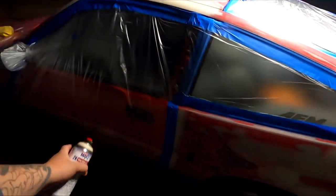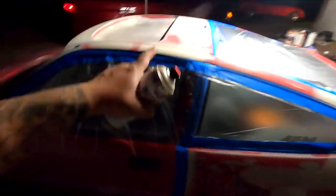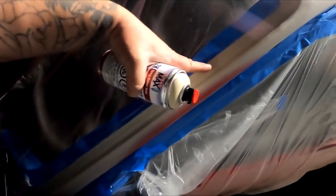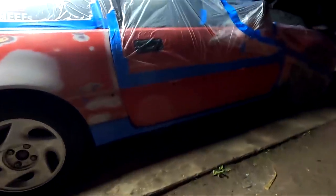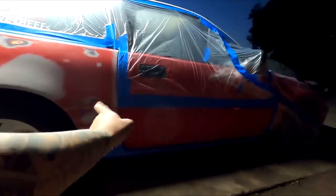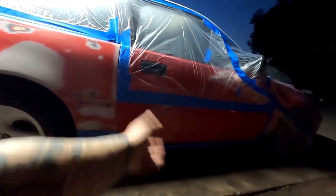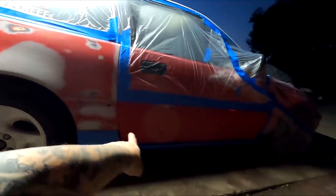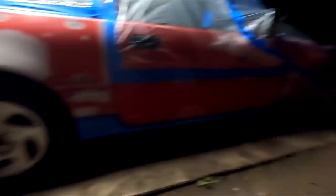We washed the entire car, dried it off, moved it over here, and masked it completely down — all of the areas that we are not painting. In today's paint session we're going to be doing pretty much the roof, the pillars, the quarters on both sides. We still got to tape up where the window sits — we're not painting the epoxy in that area. On the other side we're going to be painting the lower door as well, because when we painted that door last time we didn't take off the plastic panel. We ended up taking it off on the driver's side door, so we taped it off at the molding line, sanded the entire bottom end right here, got the hard line off because it was painted before — and we're going to paint the lower door too so that way it's all the same color as the rest of the car.